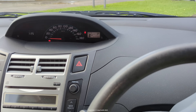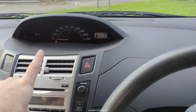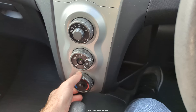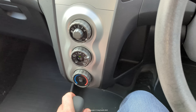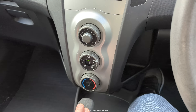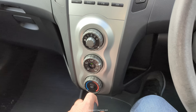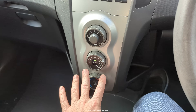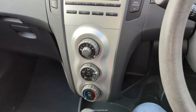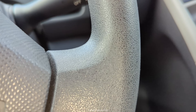I've just been for another drive and the engine is now nice and hot. These cars don't have a temperature gauge on the dash, but believe me it is hot — I had the heater on and I'm sweating. Whenever you do work with coolant like this, especially if you're trying to get the level right, you should always run the engine with the heater on, because the heater matrix is essentially part of the cooling system. You want to make sure you're getting coolant through that and working out any possible trapped air. Let's go have a look at the overflow tank now.